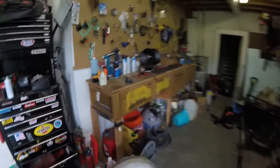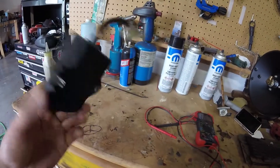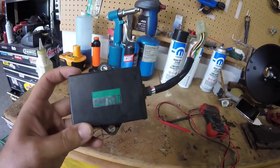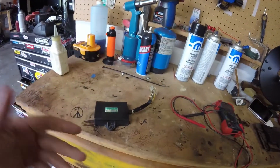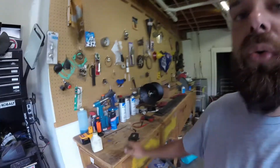I got back from vacation yesterday and I was going to mow my neighbor's yard. I'm thinking my lawnmower has a problem — I think it's my igniter or CDI box. It'll run for a little while and then shut off. I thought it was maybe the brake switch and I jumper wired around that, but that didn't fix it. I couldn't get it to start until it completely cooled off again. I narrowed it down to either this or my pulsar coils underneath it. It's a John Deere F725 lawnmower.